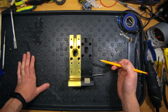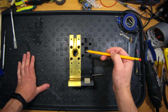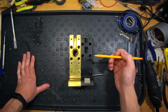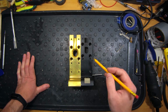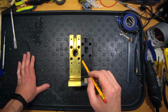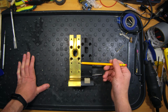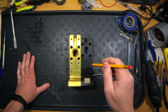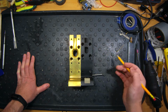Let's do a quick review. What's the difference between custom pedal hangers and the stock ones? Here you can see how the axle of the motor goes down 10 millimeters, since it gives you a 10 millimeter lift. One of the special features you have to consider is that you have to move these bolt holes down 10 millimeters, like they are located here on the custom pedal hangers, but that's basically not a problem.